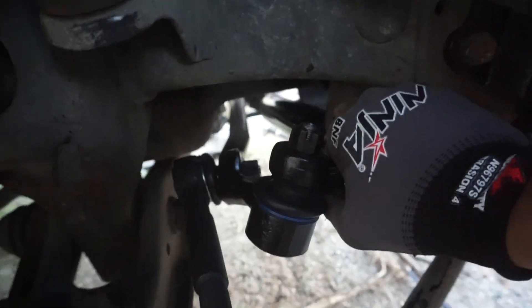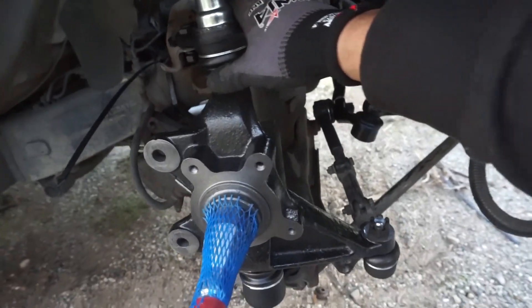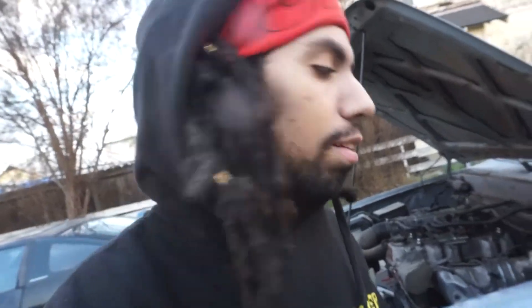Also got a new Pittman arm, new linkage arm, and new stabilizer. I also did a ball joint flip on the upper and lower — I'll go ahead and explain that in a bit. It gives you about an inch and a quarter to an inch and a half of drop, which means you can crank up your torsion bars a bit and get some spring rate back. One thing I did run into on the passenger side is the shock mount eyelet — it's in rough shape. Those little eyelets aren't strong enough to hold all the weight being dropped on these trucks.